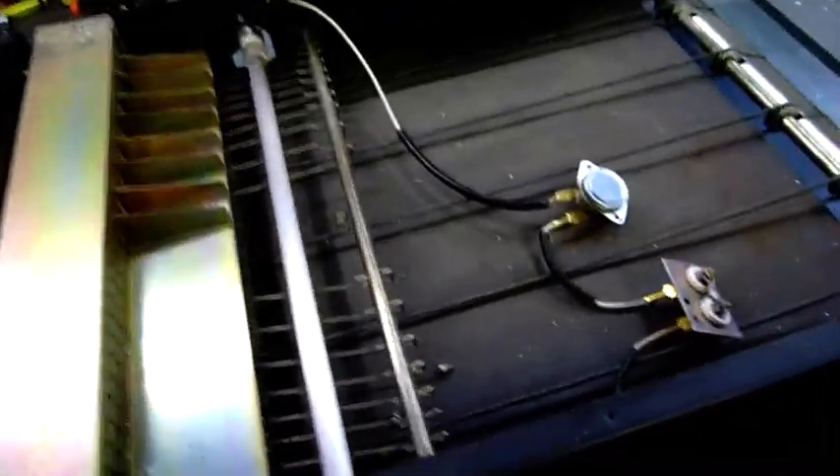There's the drying unit. That big centrifugal blower down there would force air through here — it all comes out through these holes, top and bottom — and just blows hot air over the paper as it travels through. That's what this heater's about. It's like 1,000 watts, I think. 240 volts. Bit hard to tell the wattage exactly, but I'd say it's about 1,000 watts or so.